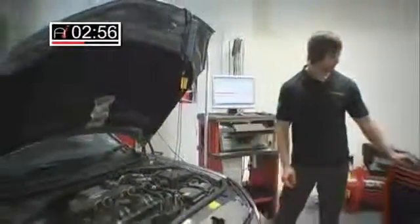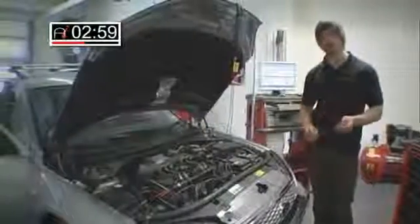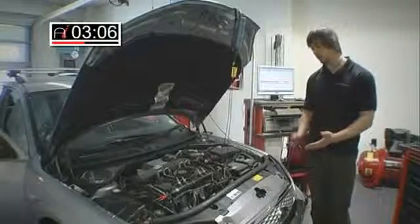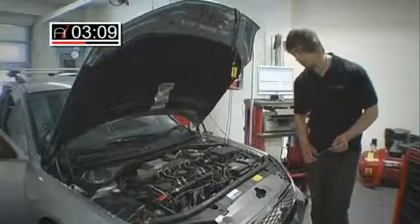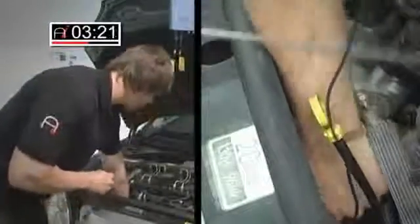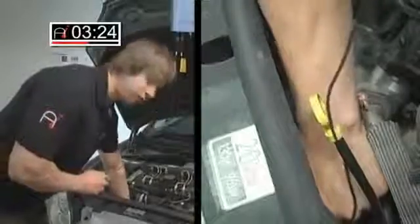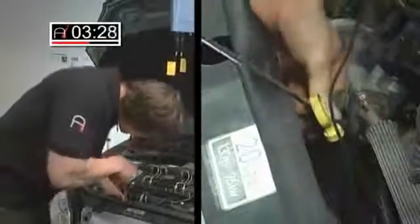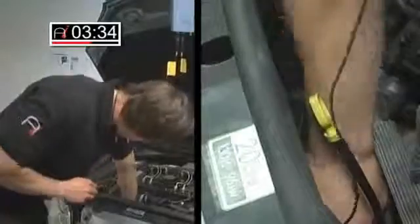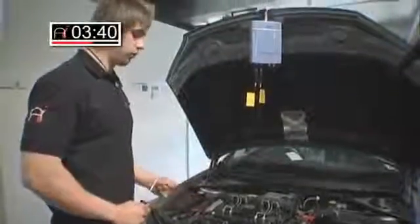What I'll do is just take off an intake hose, which will give me a very severe air leak — probably a bit more severe than a discreet air leak, but nevertheless the principle is the same. What I'm basically doing is bypassing the air that's going to be flowing through the engine, letting it escape. Now the other effects of this could be a blocked exhaust or a blocked intake, both reducing the air flow through the engine. As you can see, I've got a big split now — the air is just going to come straight back out and hopefully we'll see the result.